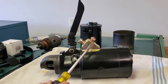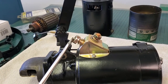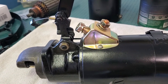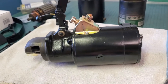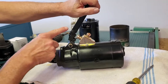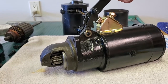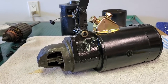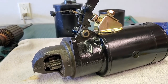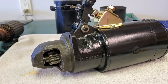Here is the electric switch that the arm will activate with the boss right here. This provides the power for the starter so it's going to rotate once that is done. When I push this — as if I'm the starter pedal in the car — you notice it brings the Bendix assembly back to the rear. This would engage it with the starter ring gear, and that portion is done mechanically.